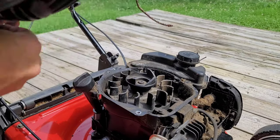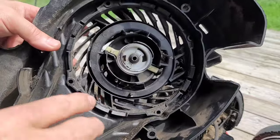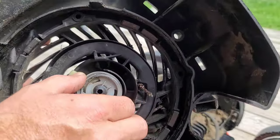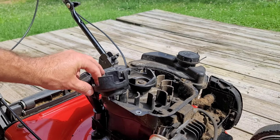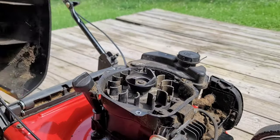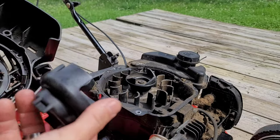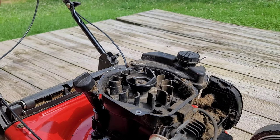Here's the inside - as you can see, this whole area here is completely rubbed through entirely. I'm guessing that friction right there is what eventually causes these to fail. You can see the difference between the new style and original style cup. If you do buy a replacement recoil like this, you absolutely have no choice but to buy the new cup - if you don't, it's not going to work. I tried to make it work and it just won't, so plan on replacing both.